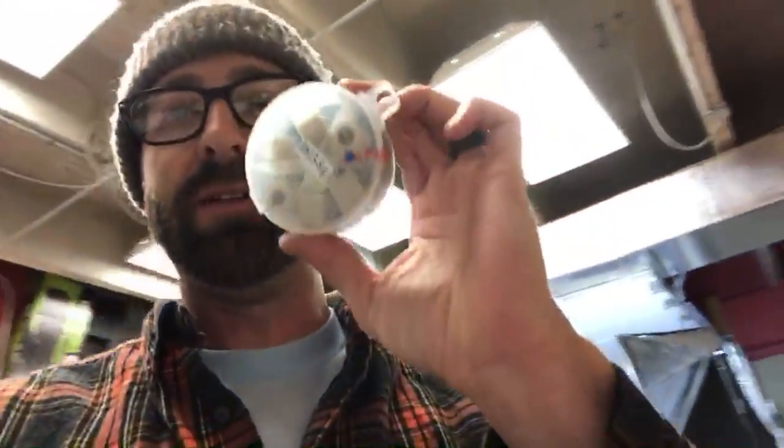So on that guy, how do you increase a little bit of speed on a stock 50cc scooter? And the short answer is back to those rollers. I don't know what that scooter has in it, but you need to figure out what the stock weight roller, variator roller size is. Say it's a 6 gram, you want to go a 5 gram. To be safe, go 1 gram less and do that in a Dr. Pulley slider. You're going to have to find out the dimensions and the weight stock, and then you can go from there. You can give us an email. I can try to help you with that.